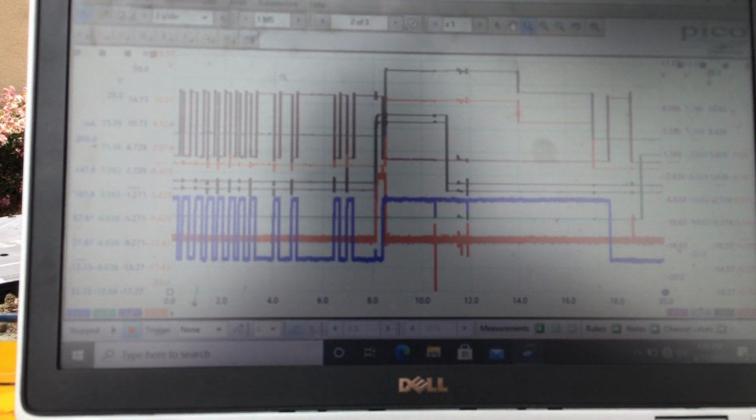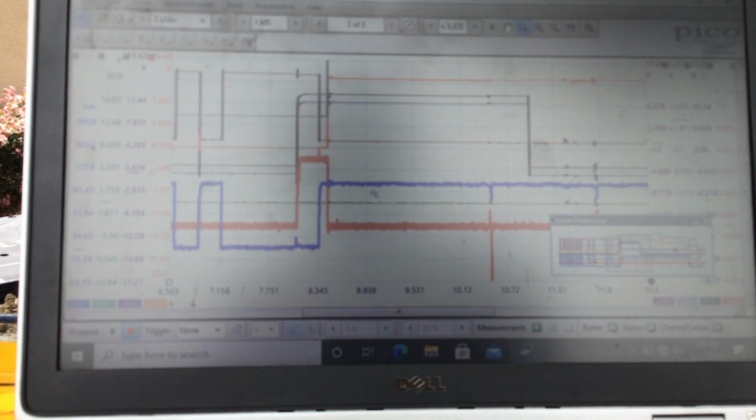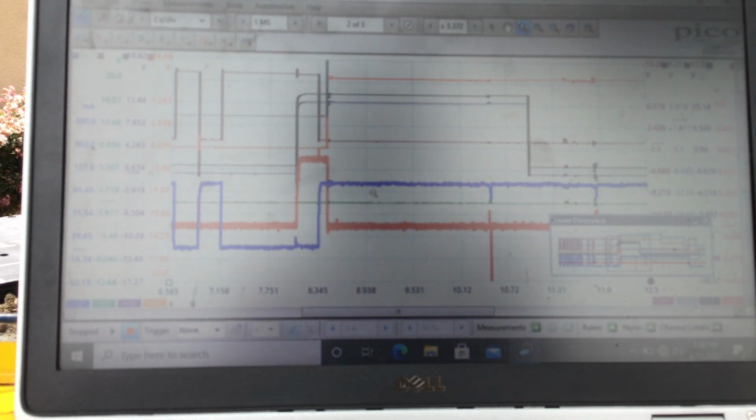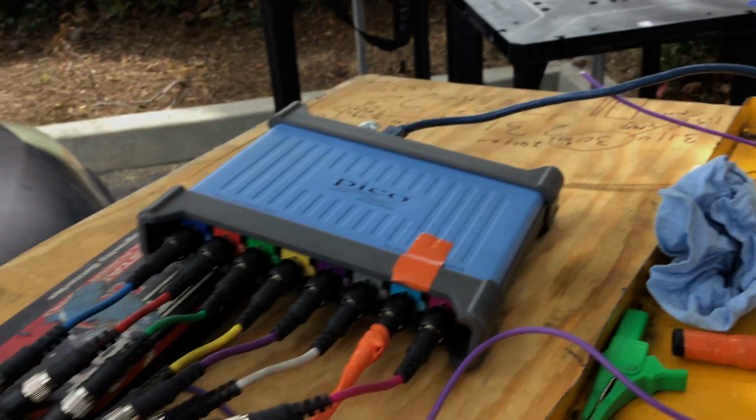And so anyway, we just look at a few more things here. I know it's been a lot of channels and a pretty challenging video even on my part, but nonetheless, this system's about action, reaction, and you don't have to hook up obviously 8 channels every time you're dealing with one. But if you have one that's giving you trouble, always remember the scope is really powerful to see that action reaction. You can validate that your solenoids are moving, and it probably is one of the better ways to do it. Yeah, hookup time is a variable, and obviously you want to think about that. Easiest places to get the wires, and I just want to show you where I'm set up before I end the video, because you're probably wondering where the clamps are.